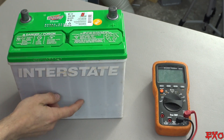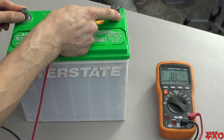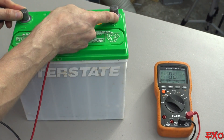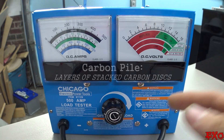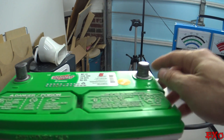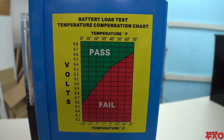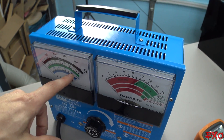We'll start out with the Megatron Group 51 and do a quick voltage measurement before we do an amperage test. It's been a couple weeks since a fresh charge, so the surface charge shouldn't be too bad. We're at 12.68 volts. Ordinarily that would be a great lead-acid battery level, but you'll never know until you put a nice draw on it. This battery load tester from Harbor Freight uses resistive loads to put out a constant draw. Anything below 9.6 volts is a fail. This battery is rated at 500 cold cranking amps, so we'll test at 250.